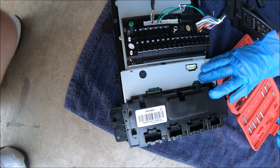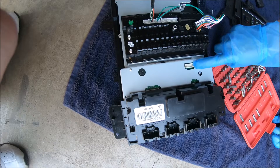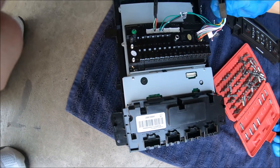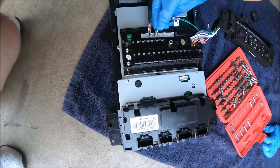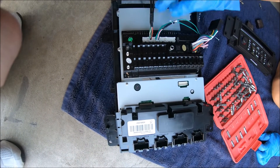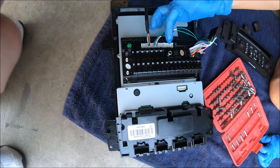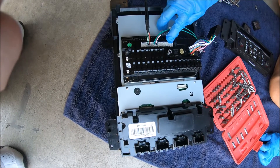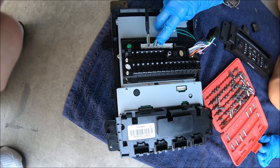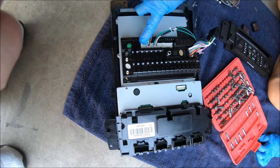This is to retain the factory AC panel. You also have this plug that comes from our power connector. We've already connected the adapter for the power — the two-pin, the two green wires — at this location, and we also have a USB connected here. There's also another USB cable here, an RCA connection that we will connect here. This one will be empty, and then this one will be your factory or aftermarket backup camera.